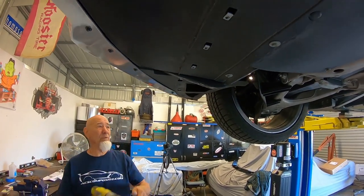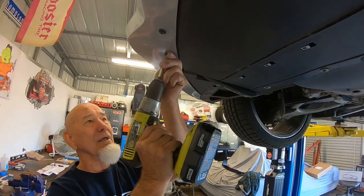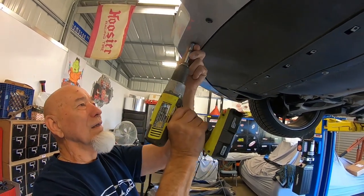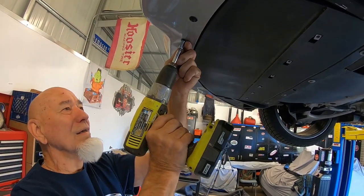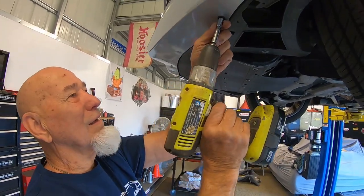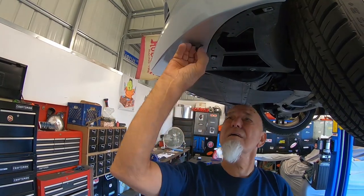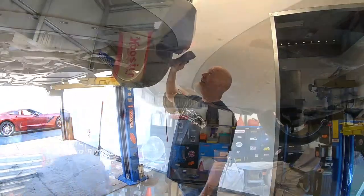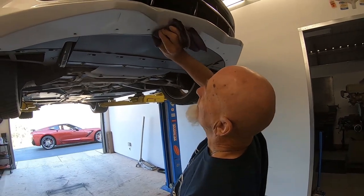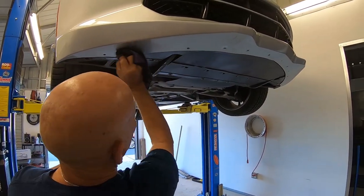This should be pretty simple because it's just the screws that are already here. The only extra part you've got here is that you're going to pull these screws out, put the splitter right back up in place using those same screws, and then we have to drill some holes for the rivets that go in front of those, so you don't get the splitter trying to pull down on you when you get air pushing against it at speed. I'm just going to wipe the bottom off and clean it up while we've got all this off.